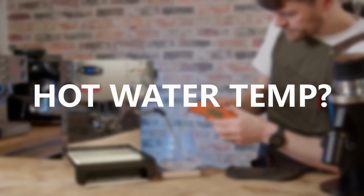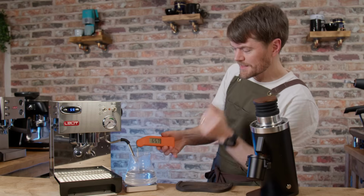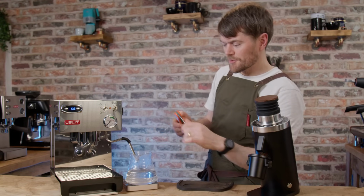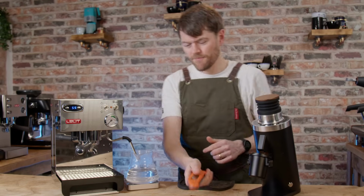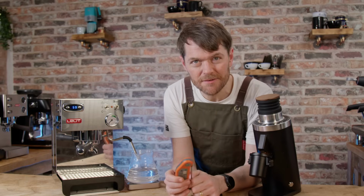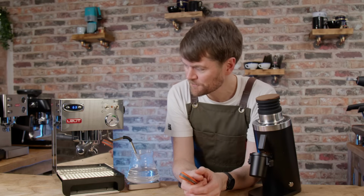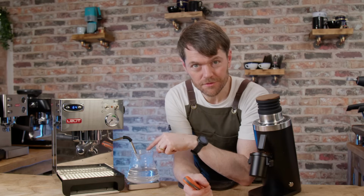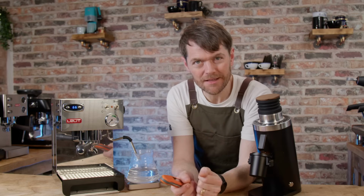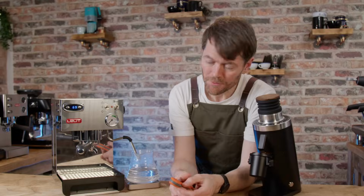What's the hot water temperature like? So about mid-60s with the brew temperature at 93. But we've figured it out, about 20 degrees in the testing. We've done about 20 degrees or so less than the brew temperature. So when we set it to 130, which is ridiculous, we were getting close to 100 degrees. In fact, slightly over 100 degree water temperature. So it's hot and powerful.